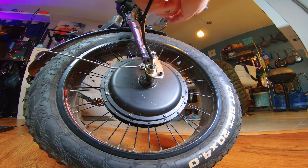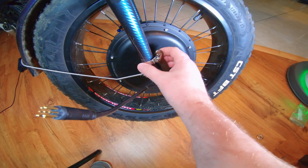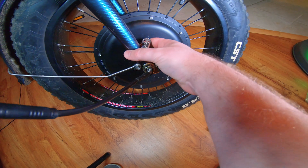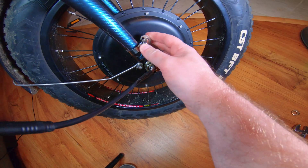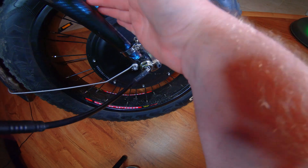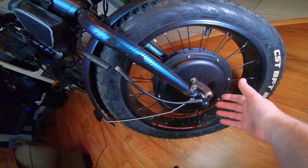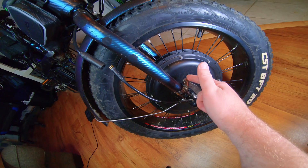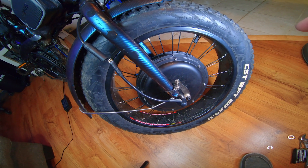Safer — not safe, but safer than what it was. So you've got your hose clamp here. I'll probably tighten it some more once I get outside and mess with it. I don't want to get it too tight because I still gotta check and see if the brakes are good. But that's pretty much all you gotta do — these two pieces and this hose clamp — and that's called a torque arm.